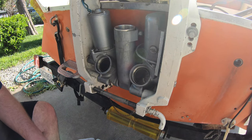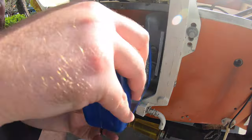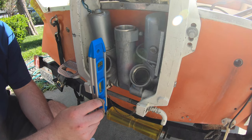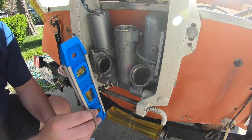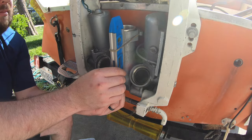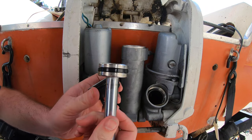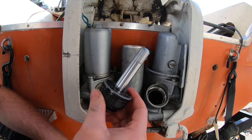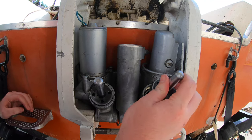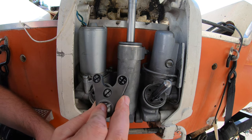Now that I have the piston sleeves back in, I'm going to fill up these reservoirs as much as possible. If you want to be accurate, you can use a level to get this piston as plumb as possible — it does matter whether the reservoir is plumb, but a little bit either way is alright. I've got my new piston and o-ring seals complete. I'm just going to insert this just like that. You will meet a little bit of resistance because there's pressure in the system. Then I can take my little tool here and crank them down.